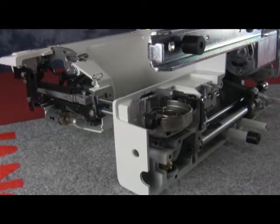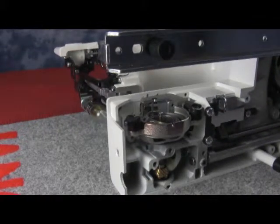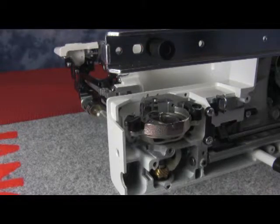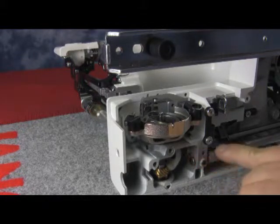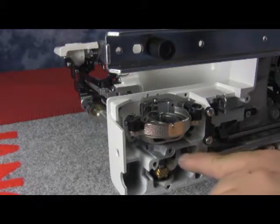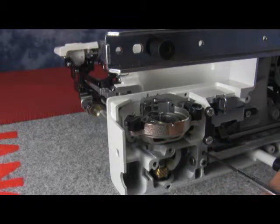And we're going to tighten the bushing. And we'll turn the hand wheel. Since we loosened the bushing and moved the gear, we have to double check the backlash once again to make sure it is turning smoothly. And if need be, make a little adjustment, loosen that screw, and move the shaft to the proper position once again to adjust the backlash. We will tighten the bushing screw.